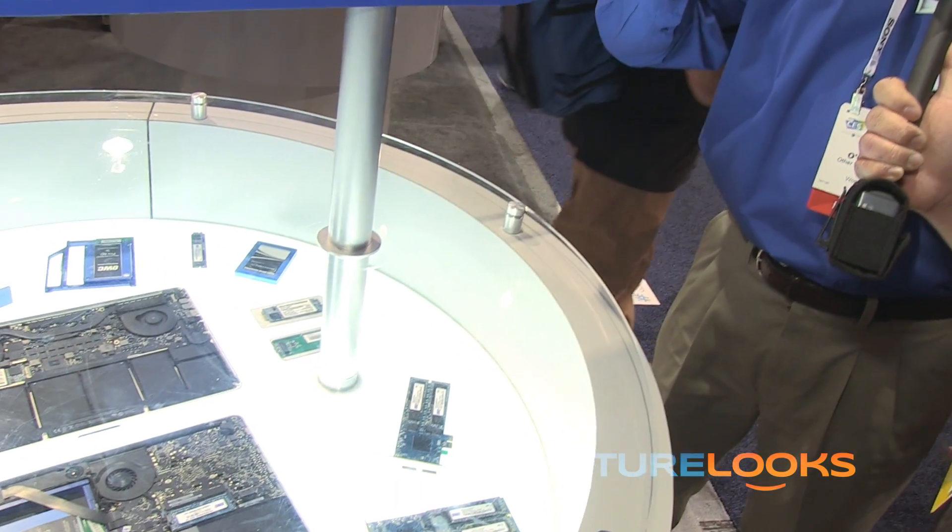Just like the new Mac Pro, it's based on PCI SSD storage. Putting this into your existing Mac Pro — 2006 up to the 2012 model — absolutely transforms that machine and levels the playing field. For just about everything outside of where the GPU comes into play, a previous Mac Pro — even some 2012 models — actually have higher processor scores than the new models. With up to 128 gigabytes of memory and our PCI SSD, you can bring new life to those systems for literally a few hundred dollars. That's going to rival what a stock 2013 can do for you, keeping those machines running and very valuable on the used market. Since the 2013 came out, used 2009 to 2012 Mac Pro availability has gone down — people have been gobbling them up — which shows that upgradability is important to Apple users. I'm glad Apple left the opportunity to swap processors, because it's an expensive piece of hardware and it's nice to know it has a future.